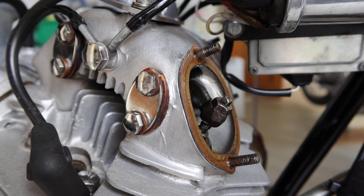So now I don't have troughs — I just have tiny little witness marks at the top of those lash caps, with the valves 80 thou, or 180 thou shorter to make up for the 100 thou of the lash caps. And my valves never need adjusting.